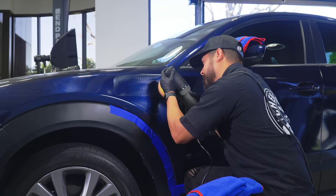With this one right here, you're gonna use it the exact same way. You're just gonna wanna apply a couple drops. In this case, we'll do three. We'll set that down, and then let's go ahead and hit this section one more time, just with a finer approach like V38. The polishing stage is really just intended to refine your paintwork. It's designed to smoothen it out and bring out the utmost clarity and shine possible, that way you have the best finish possible. So we're just gonna go ahead and work this in. Same exact process as we did with V34, but now with V38.